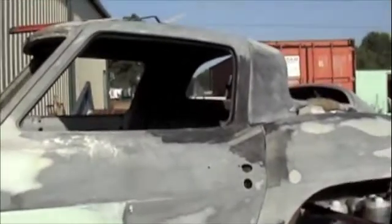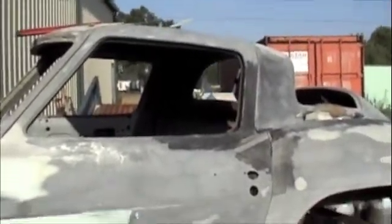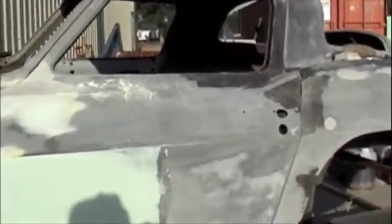We've already gone through and worked a lot of the spots where we've dug out old putty and reinforced the crack lines, and went to a resin film mix, which is a thick mix in fiberglass, to give it some strength and do it the proper way. So the thing's moving along pretty good right at the moment.